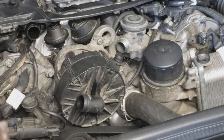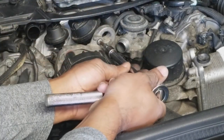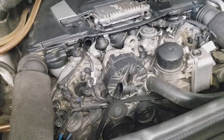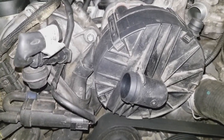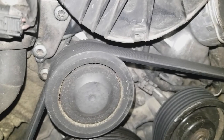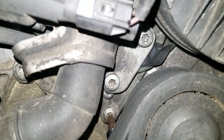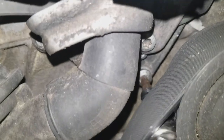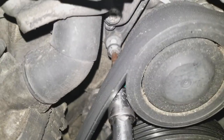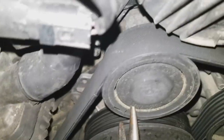These hoses seem good. I'm going to start off using my Torx T30 with an extender just so I can get in there. Moving the camera in for a closer view for the next set of bolts on the left side of the secondary pump — you'll see some bolts nestled inside there. I'm going to go after the one at the base first, then come up, grabbing that bottom one using long needle nose pliers so I don't lose it.